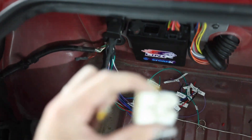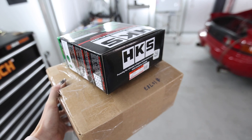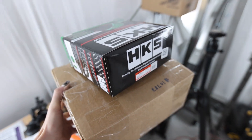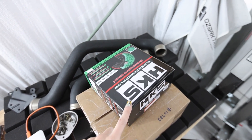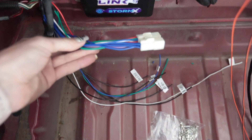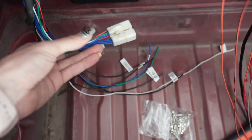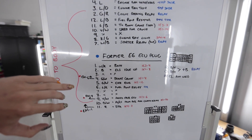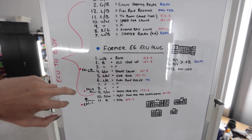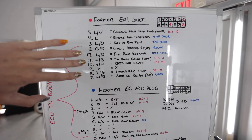Now all of those need to get inserted into this. Welcome to tomorrow — I cannot believe how much time this wiring project is taking. I knew it was going to take a while, but damn. Because I'm deleting the AFM on the car, I had to get a new intake — my new intake is here. This is the red filter, the double layer oiled filter, and it's red because I don't want a Christmas car. EA1 is now fully complete — I got everything pinned and I actually added a couple extra circuits in empty slots. Now I'm going to do the other end of this that will run through the rear firewall and go to their corresponding plugs, which is primarily just the cruise control, fans, and AC. It made sense to have all the cruise control stuff on the same plug.